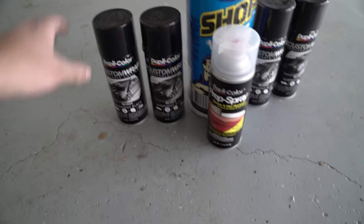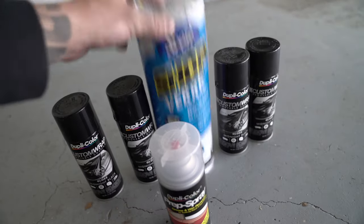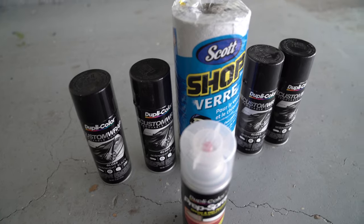So this is what we're using today: Custom Wrap Removable Coating from DupliColor, some prep spray, and some shop towels to clean them off. You could add a clear coat if you want a little stronger finish — we'll probably end up doing that. While the wheels are off, since we just added wheel spacers, this is the best time to check them. I drove it around about 7,500 miles already. For all the wheel spacer haters — the wheel spacers are still good, 120 foot-pounds, still torqued perfectly. Biggest thing with wheel spacers is just the maintenance, always checking them.